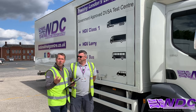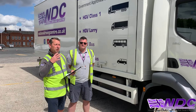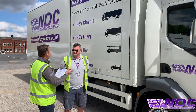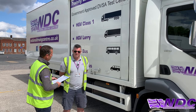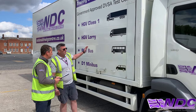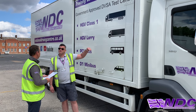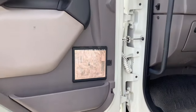Now we're going to move on to something really important — securing and loading the vehicle. Can you explain the safety factors involved when loading these vehicles, please? When loading the vehicle, I would start from the bulkhead — heavier stuff at the bottom, lighter stuff on top. I'd make sure they're nice and secure, evenly distributed across the axles, and I can check this against my VOSA plate.